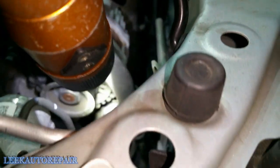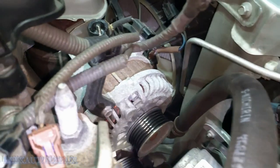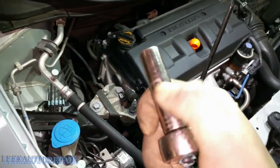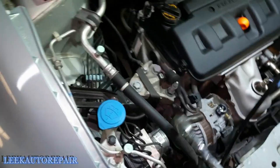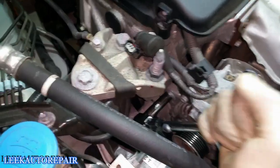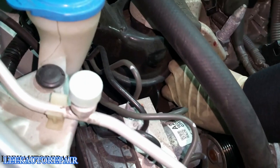The second bolt is right down in there — you can't see it easily, but take your fingers and feel around and you'll find it. They're both the same size. Take your tools and remove it. I've got my 3/8 ratchet — a long one. For that top bolt a deep 12mm socket works well. Righty tighty, lefty loosey — turn left to break it free, then put the ratchet back on and spin it off. If it's loose enough you can just twist it off by hand.